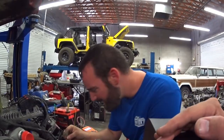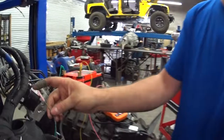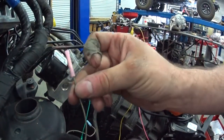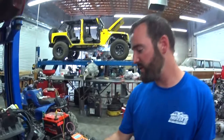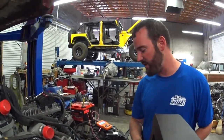This is a brown/green or brown/yellow wire — it depends on which harness you have — but I'm going to put a red connector on it. This is for your fan PWM output, which controls the signal and speed of your fan. It's pretty much the only two wires that you'll have hanging out there that you need to splice in.